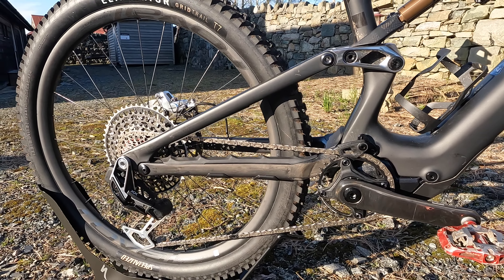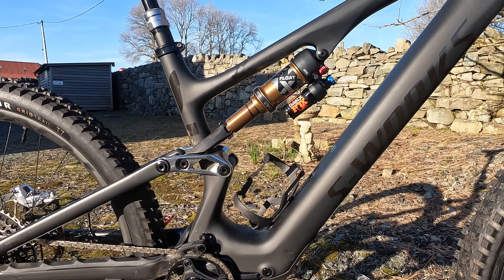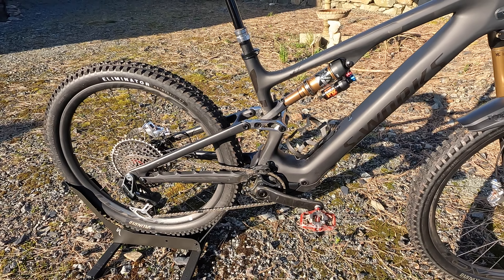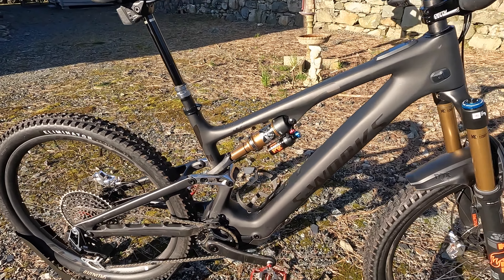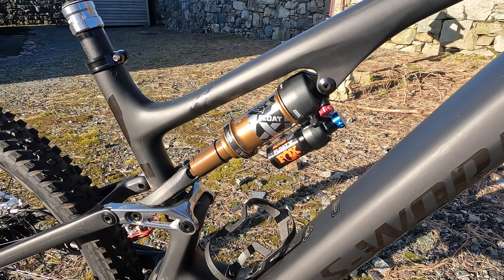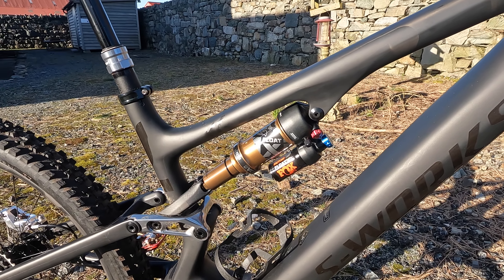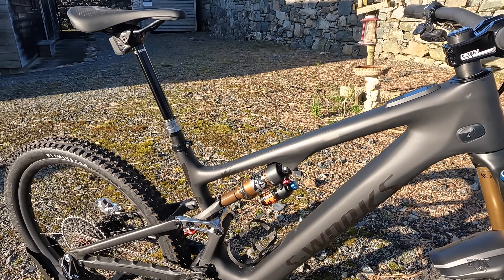The layout's the same but you're getting more anti-squat, a more rearward axle path for the rear wheel, and a more linear shock response as well. So big changes to the way that back end behaves, even though it looks very similar — and those are pretty obvious on the trail. It still feels like a 4-bar but it's definitely more positive with more kick on the power, and it takes big slap hits a little bit better than before. They've also done a full custom tune on that Float X shock: very light compression and rebound to give the bike some pop, but it's also got more support off the top and better ramp up at the end.